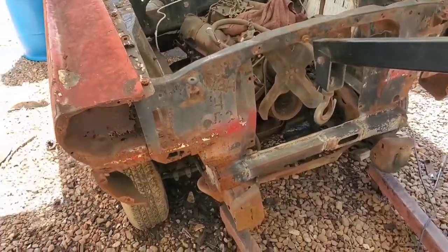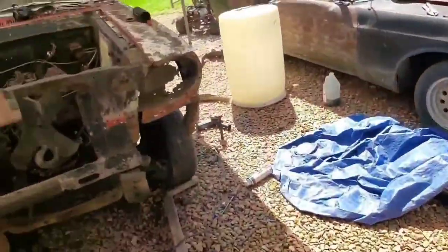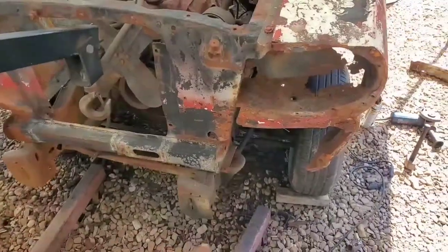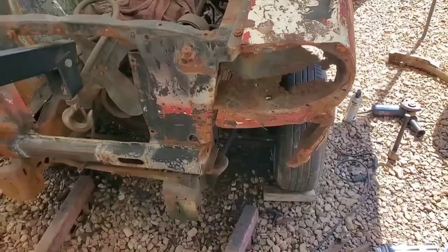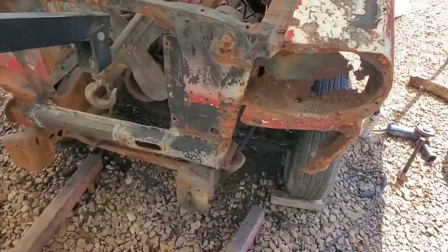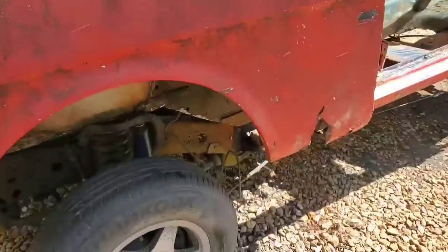That includes even attaching to the bumpers, maybe. I have to see how all that garbage fits back together. It's kind of a complex little puzzle of garbage that goes together. But again, I have to make mounts for these two tabs. I also have to jack this back up one more time so I could box in the open points on the subframe so I can wrap up the subframe. That way we can move on to actually doing our mounts.